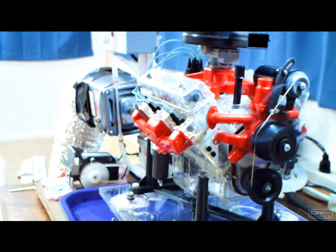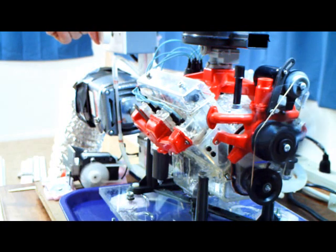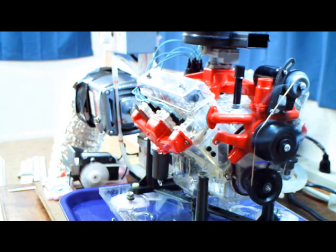This is going to be a run-up as part of the run-in for crankshaft number 4 on the visible V8. We're going to turn the oil pressure up to 10 pounds. Oil pressure is about at 10 pounds, and the oil temperature is about 80 degrees right now. We're going to run it for a little bit here at 3,500 RPM.